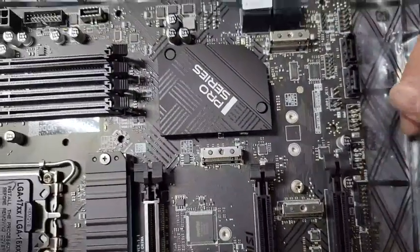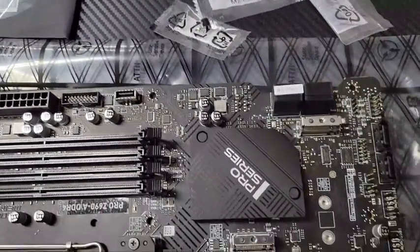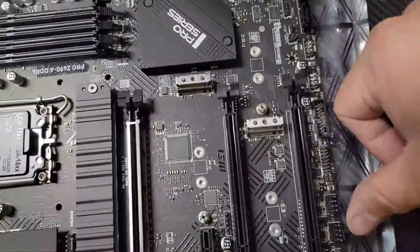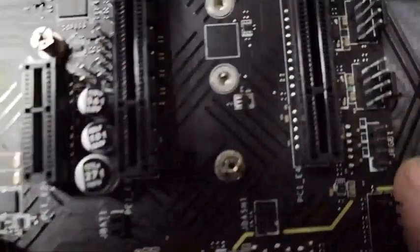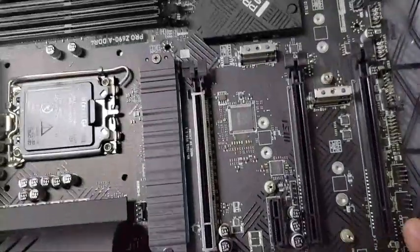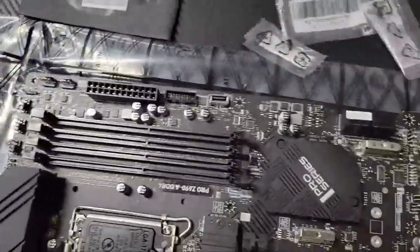All the jumpers connect here — the jumpers that go to the front panel, the SATA connections are all embedded in here, and there are more connections for fans and other jumper types. Here is where the RGB lighting connects — it says RGB1 right there. You need to know how to connect these properly. There's a 5-volt header and a 12-volt header — I have to check the manual to make sure I'm connecting them correctly.